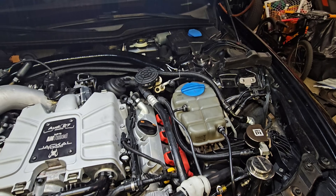That about wraps it up for this DIY. Button everything back up. If you have a divorced coolant loop, without even putting the supercharger on you can put a vacuum bleed tool on your coolant reservoir for the engine loop, pull vacuum, and if the gauge holds for 10 to 15 minutes you know you're good to go. If you don't have a divorced loop, do it the old-school way: put everything back together and fill with water or antifreeze and check for leaks afterwards. Shoutout to German Performance Solutions — they're awesome and sent this out for me to do this video. Links in the pinned comment. If you have questions, drop them below, consider liking and subscribing, and I'll see you on the next DIY video.